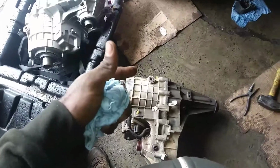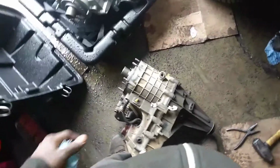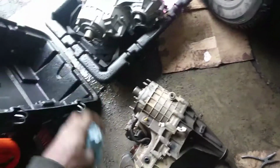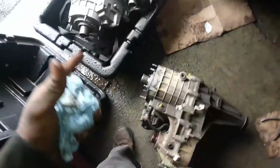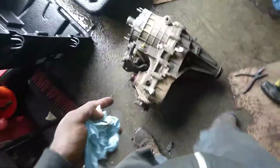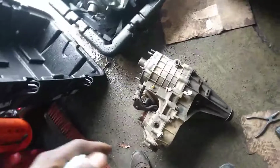But other than that, I'll just get the footage of me putting this joker back in. I mean, it's not that heavy. You know, you get a good position to bench press it up. But I can understand how difficult it can be. When I pulled the one originally, I did put anti-seize on the inside of the splines to make life a lot easier when removing it. Unfortunately, it didn't come with the dust cover because the one that was on there originally ripped up. So it does help when removing it again, putting just anti-seize like you would normally get for any other bolt, the copper looking stuff.